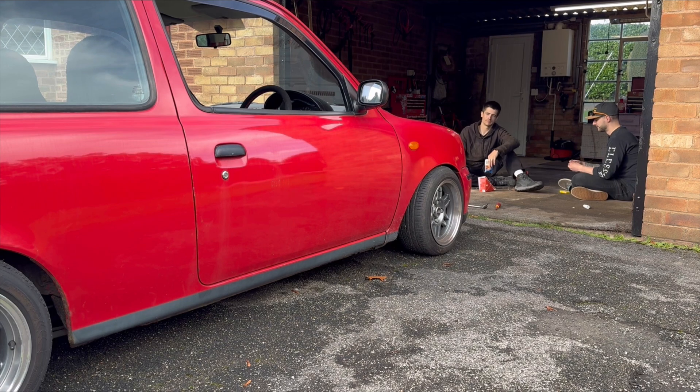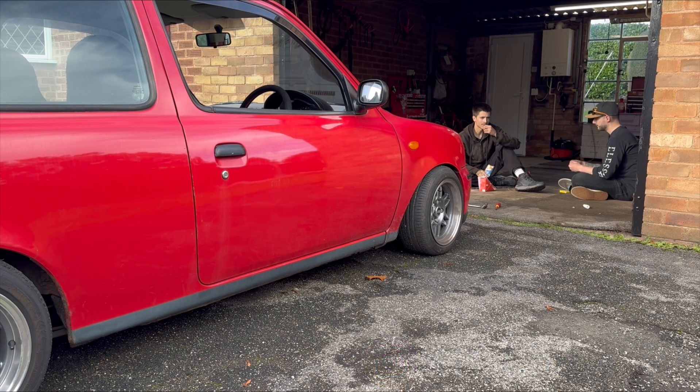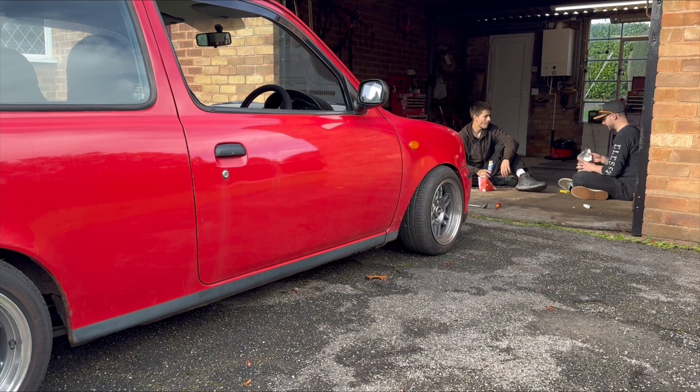Going to have to leave it there for today unfortunately. The cams were all installed correctly and in place, but the engine wasn't running. You can hear it's just spinning freely and not really trying to fire. We ruled out spark by testing it. We had a similar issue on another car before — turned out to be timing. We don't think it's going to be that, so I'm going to gather a few opinions and get some help on it. It's going to be a two-parter — that was part one, hopefully you got some value from it. I think it's just how aggressive the cams are — it's just going to need fine-tuning or having the valves adjusted. We'll get to it and be back soon, thanks for watching.